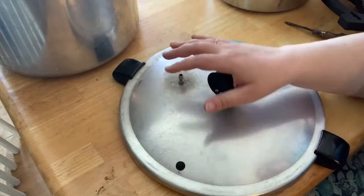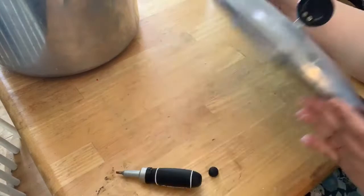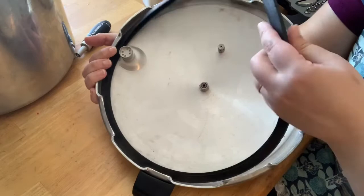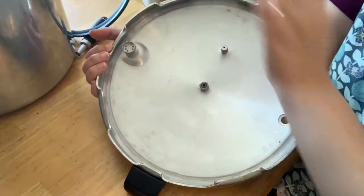The first thing we're going to do is take out the emergency valve — so your pressure canner doesn't explode. I'm going to take a flathead screwdriver and just push that through there. Next I'm going to remove this rubber seal — all you do is pull it out like that. Mine has started leaking, so when I'm pressure canning I can see water dripping out of it, which tells me I need to replace the seals.